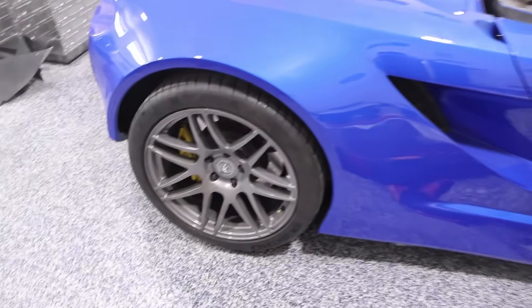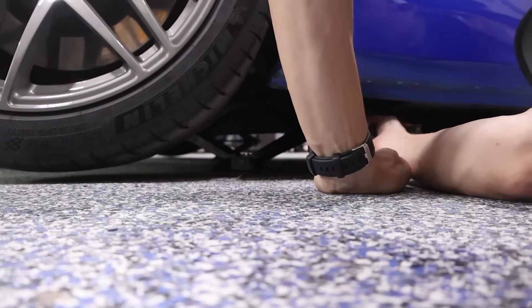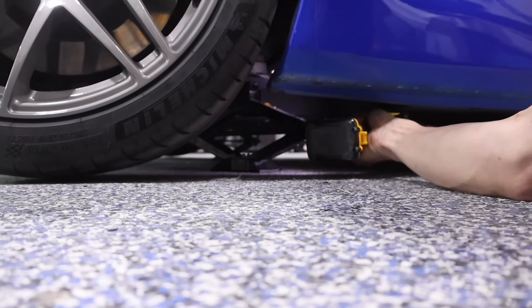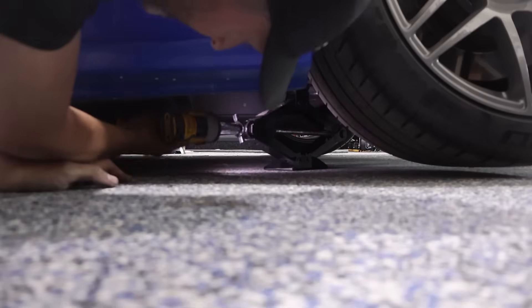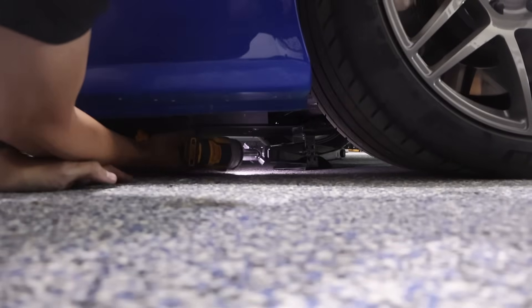So there's going to be some more things we need to figure out — like reverse lights and brake lights. Reverse lights are on, we did figure that one out — that was Russ, he was smart on that one. But no brake lights — we need to figure out brake lights. We're also going to do what I'll call a soft start, meaning we're going to limit power and take it just around the block before we let her loose. We've got the motor spinning the wheels again, but the wheels are off the ground. We need to get this off the jack stands and take it out for the first drive with the new motor controller. We've limited it to about 100 to 150 amps, so it should not see crazy acceleration — just trying to test some circuits and make sure everything's doing okay before we start turning it up.